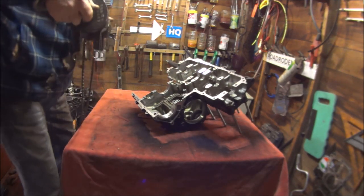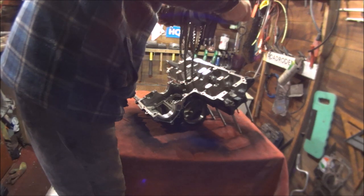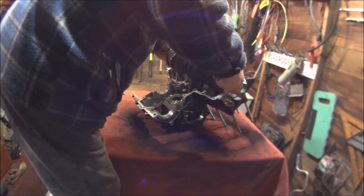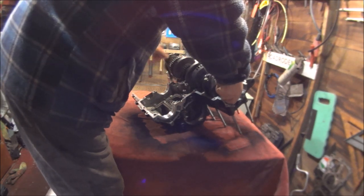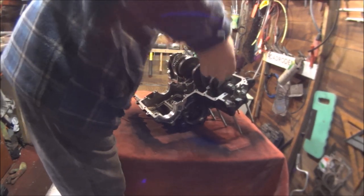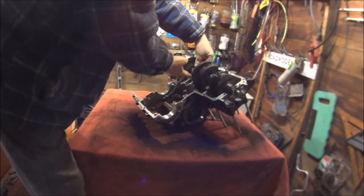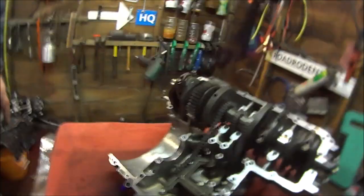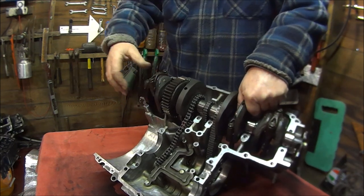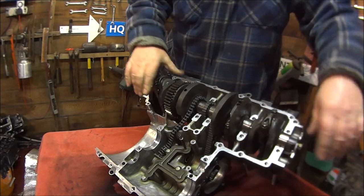If you bring the conrods to the top you can see a little notch — if you think these have dried up you can squirt a little oil in there too, just to make sure. Right then, so now we should be able to lift the main crank into the engine. Drop your cam chain through the centre hole, because that wants to go to the top of the engine, but the other two chains want to stay this side of the engine. Be careful how you get everything in because it's very heavy and it can trap your fingers. Make sure all these chains are free and that one is going through the centre.